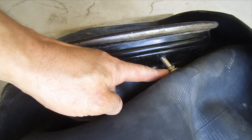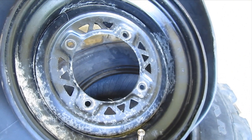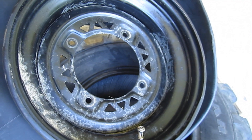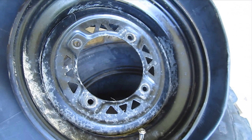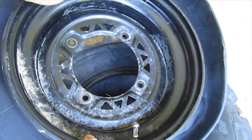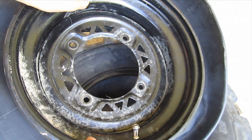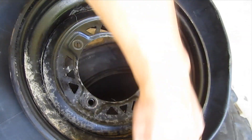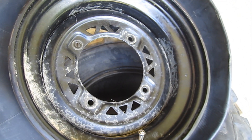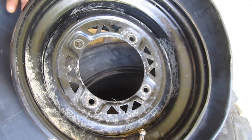I've got one nut on the inside of the rim and one on the outside, and I'm going to leave it loose. Per the instructions on the inside of the tube box, I'm going to put a little bit of air in the tube — just inflate it slightly. Then we're going to start trying to put the tire back on. It says to use soap and water as a lubricant; I used WD-40 before and it evaporates pretty well, so I may just use that again.